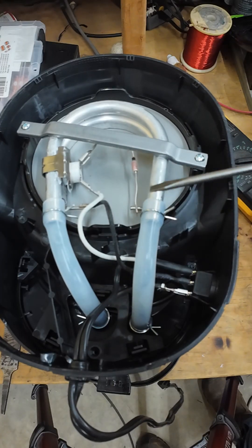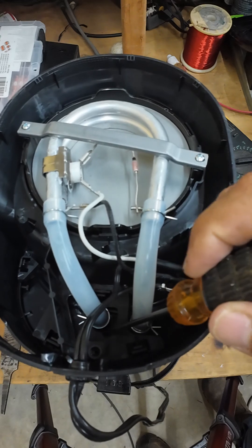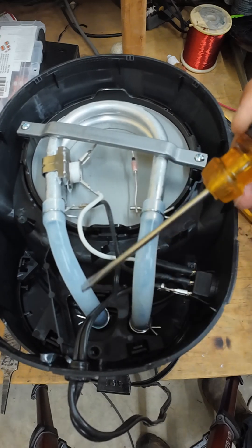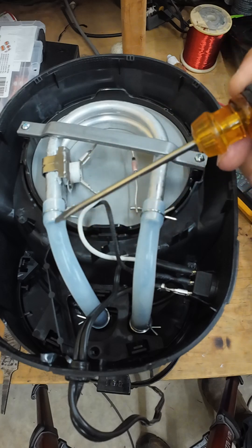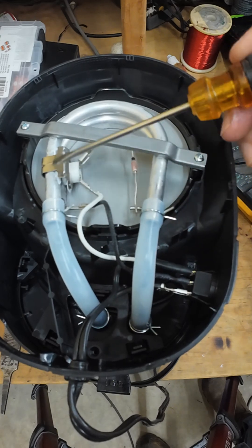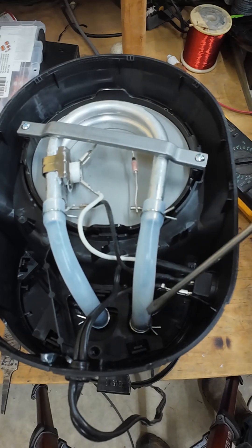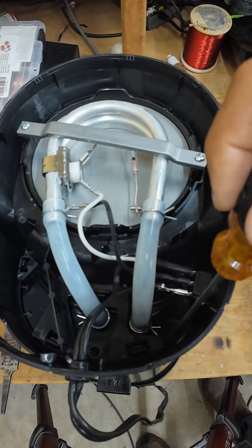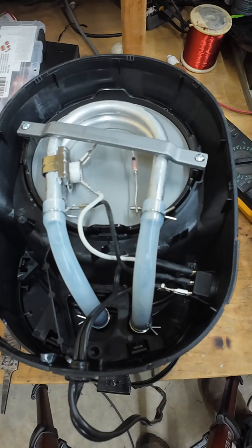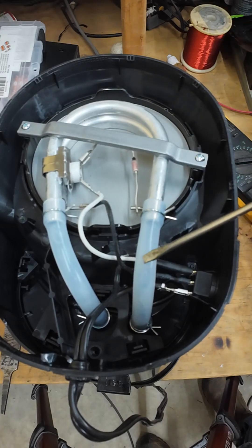So what's happening here, a little theory of operation: you got your tank of cold water in there, gravity's feeding it down here. This is upside down, so normally gravity would be feeding into the tube here and heating up the water, then it pushes the hot water up and out into the filter cup.